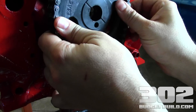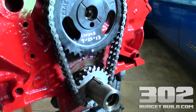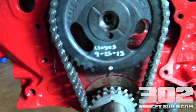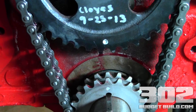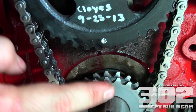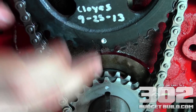Take your time. Make sure it's a little bit down there. There we go — starting to go on now, and we're just about there. What I want to stress here are these two dots right here. These two dots have to be perfect. You can't be one tooth off or anything like that. You have to be perfect with your alignment of these dots because these dots are critical — for every revolution, these dots need to synchronize with one another. So this is your primary key here.